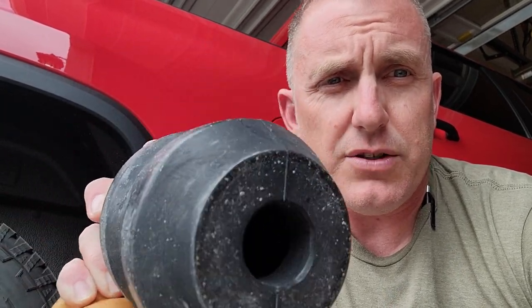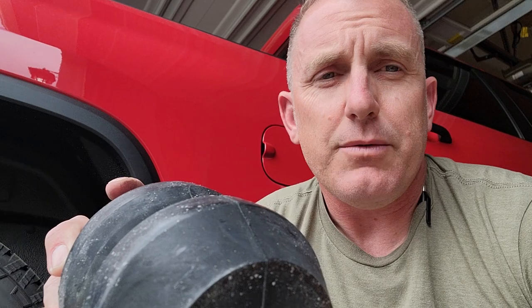I've already removed one of the factory bump stops, but I just want to go over what these do and what they don't do. I do have a set of new pack brake airbags in box, but I'm not going to install them on this truck because they take a lot of upkeep — you have to adjust air pressure all the time unless you have the onboard compressor, which I had on my old diesel dually, and it was obnoxious and noisy.